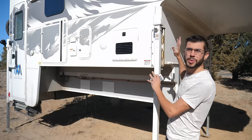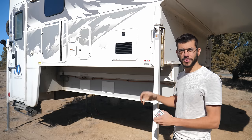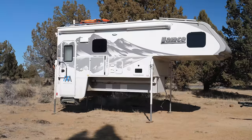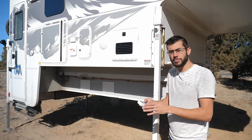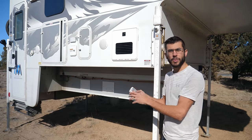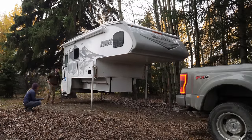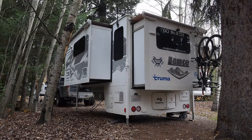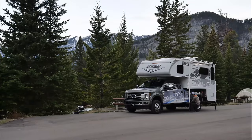Now that we're off the truck, the camper is pretty high because we had to lift it well off the truck, and because of that with the narrow legs it's actually kind of wobbly. So we lower it as low as we can go to the ground to maximize stability for getting in and out. As we lower it we need to make sure all the legs lower at the same time, as one motor may be faster than another — watch it and if one is going faster, stop and make sure it's pressing into the ground for a nice even movement. The truck camper can also be lowered just until the steps are near the ground, and once lowered, if you have slides you can put them out. Be sure the jacks didn't settle or slide after taking it off the truck, as this can cause the camper to torque and bind the slides.